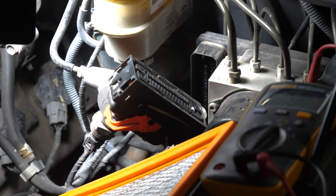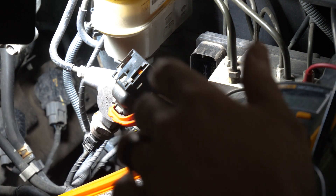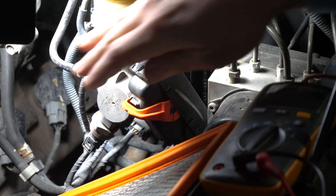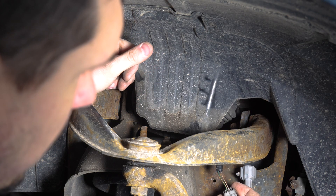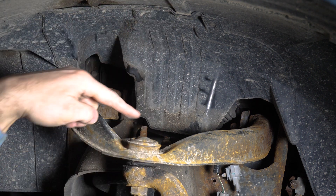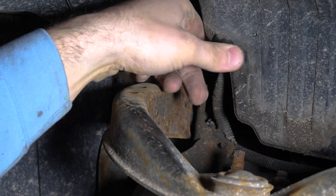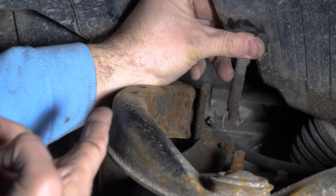So that's wonderful — I think we may have found the problem here. This runs down into a loom, goes all over the place, but luckily this is a really short run. It goes from here, runs down, goes around the air box, and then down into the wheel well. If I pull back my wheel well cover, you'll see the loom is torn and there's only one wire in there. Let me peel it back — and look at that. There's our wire.